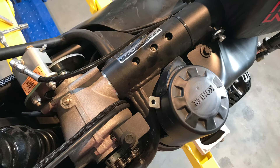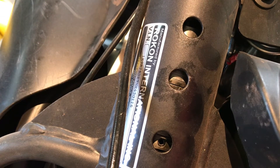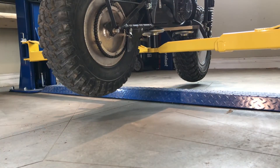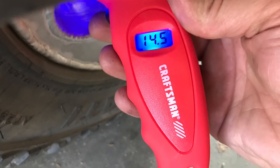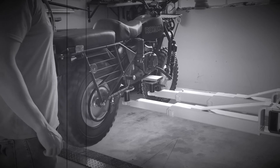There are other roll pins all throughout the drivetrain system, so look through these inspection holes if that particular one isn't the case on your bike. Push the old pin out, replace it with a new one, and you'll be back on the road in no time. Once we're done, put the bike back on the ground, make sure the tire pressure is equal in the front and back tire, and then we've got a two-wheel drive Rokon that will take us almost anywhere we point it.